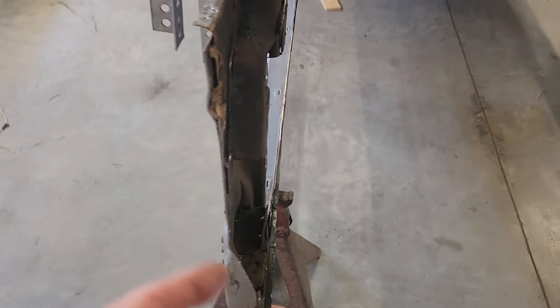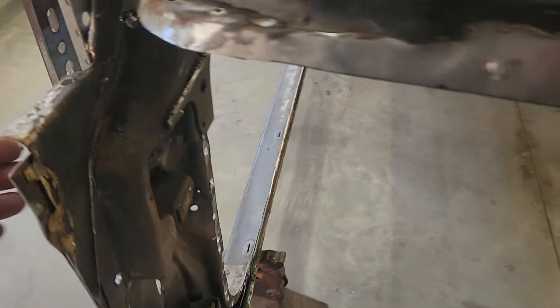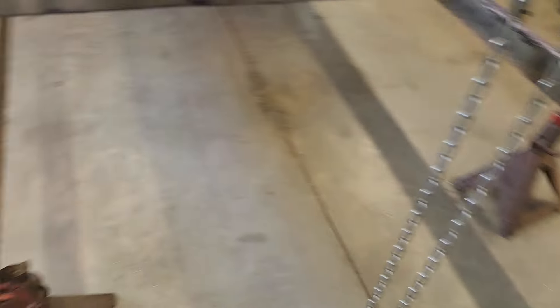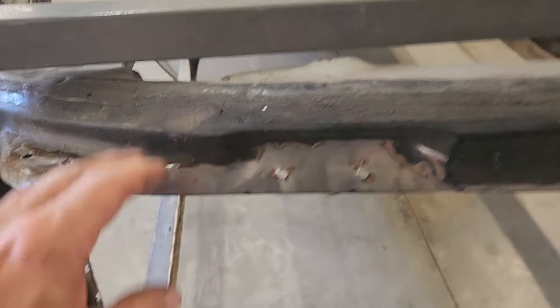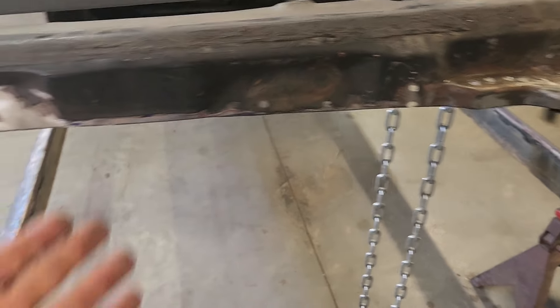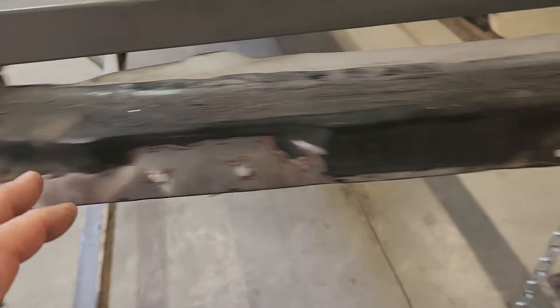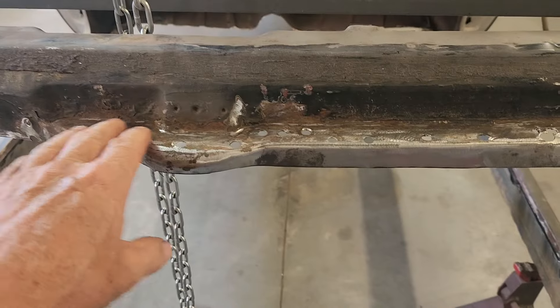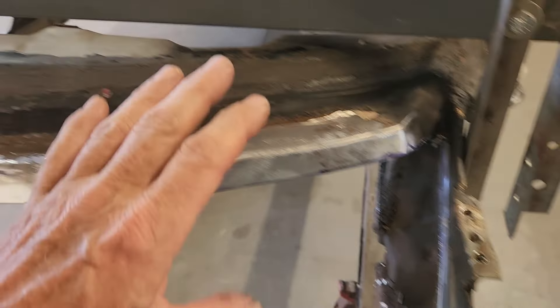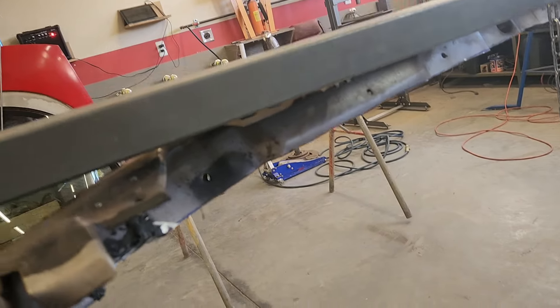I like to minimize what I cut off just in case I need it. What I have here is aligned with the pinch weld for the most part — these are a little larger, these reinforcement pieces for the hinge plates, which I wanted to maintain. Everything from the pinch welds out is what I was looking to keep. It was a little harder to decide where to cut the dashboard. I needed to maintain some of the mounting points for the brackets that hold the windshield up. On the inside there was a double skin — a skin here and then the skin from the firewall itself, so I had to pick a point where to cut. The most difficult spot was down in here because there was a lot of stuff coming together right in that area.